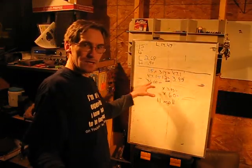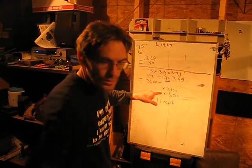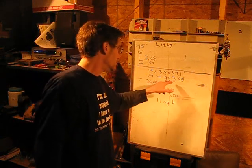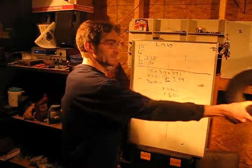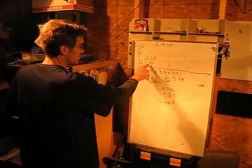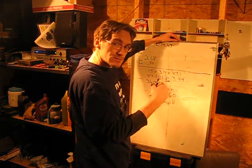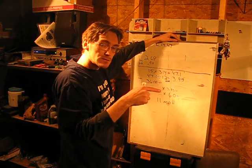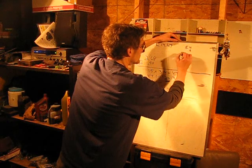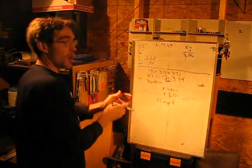Okay, so we're going to get rid of everything we're not going to be using. We know that 15 inches of tire times pi equals 47.1 around the whole circumference of the tire. We divide that by 12 inches, and we know that's going to be almost 4 feet of travel. The tire is going to roll about 4 feet. You take 3,600 RPMs of the engine, and then you factor in the high end, which is 0.90. Remember, the sprocket on the axle is going to be 5.4 with a 10 tooth sprocket on the jack shaft. So 5.4 times 0.9 comes out to 4.86.